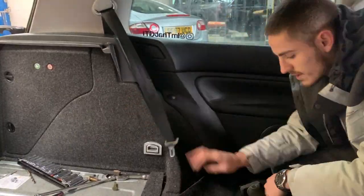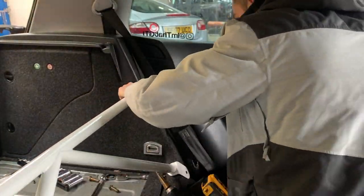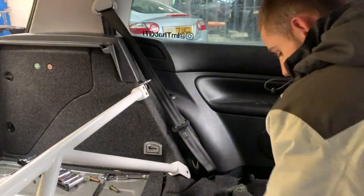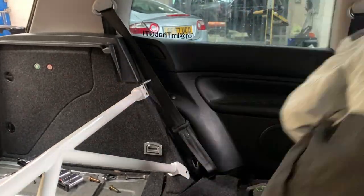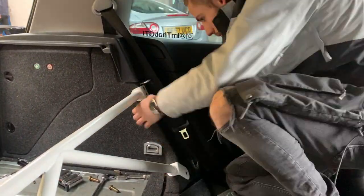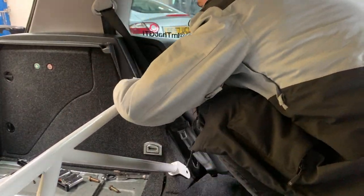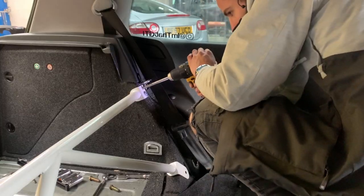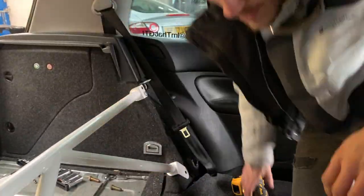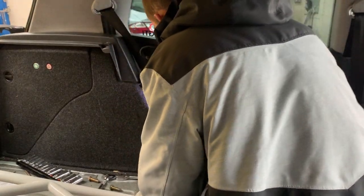That's just the tip I used and it seemed to work for me — drill a hole, test the K-brace, then drill through the K-brace onto the next hole, and keep doing that the whole way around to make sure all the holes line up. Trial fit it and make sure you use the rivnut and bolt that they provide, otherwise it will not be secure. There is a video online — I will put that in the description — on how to use these rivnuts, as they can get quite confusing. Just focus on what you're doing and you should be good to go.